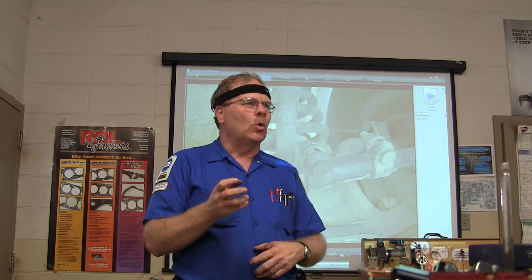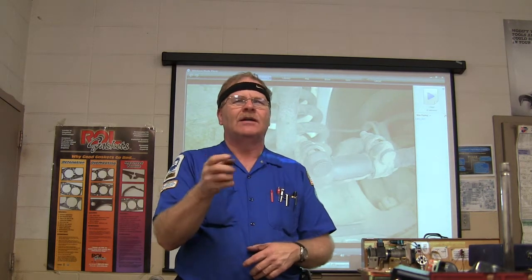So we were going to change that tie rod end, and this guy Joel was helping me. I said, what we're going to do to kind of get ourselves in a ballpark when replacing a tie rod end — what do you do? You can mark a thread, that's not a bad idea. What else can you do? You can count the turns, right? Usually it's about 22 turns. How do you count the turns on a tie rod end? Every time you pass 12 o'clock, you count a turn.